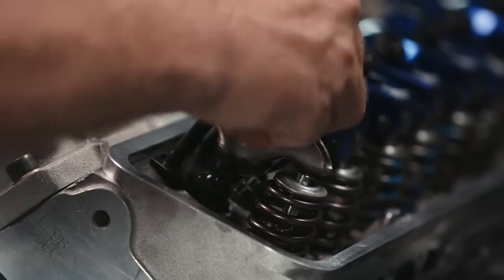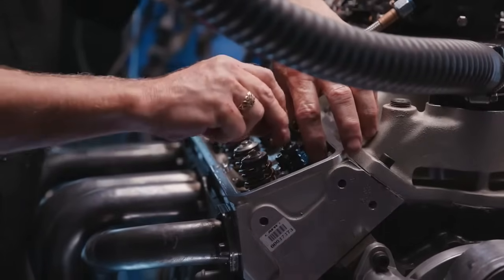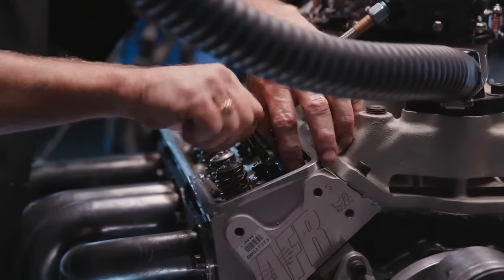We're set for our baseline — the very first run with the stamped steel rockers. It's a little unusual to use a stamped steel rocker with a cam this big. One thing cool about these rockers: it's a 7/16 stud, so we may have a chance of this thing staying on. I put some poly locks on it and got rid of the jam nuts. There are classes, like circle track, that call for a stamped steel rocker — that's probably why these Howard's stamped steel rockers exist. They are aftermarket but equivalent to stock rockers, just beefed up a bit, and it's cool that they have the 7/16 stud.